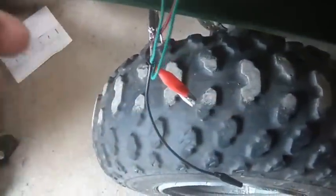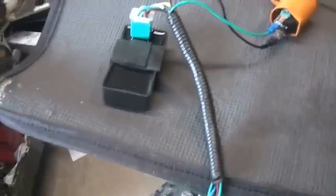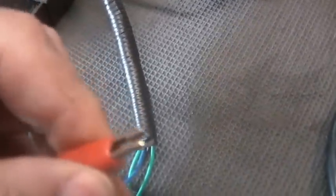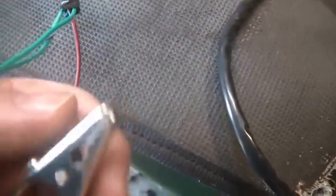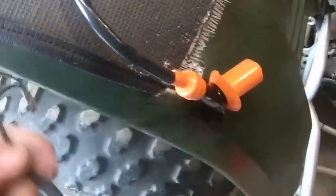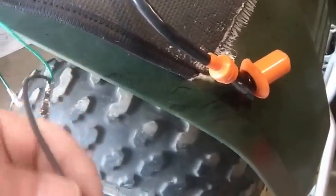When I plug in the blue and white, I'll now have a nice pulse generator. I've just hooked up three wires. Other than that, all I have to do is worry about the power, which is black and red. So I'm going to hook that right to my battery. I've got to worry about ground to make the spark plug spark, to ground the case, and all those other wonderful things. I've got to hook up power to this whole system.